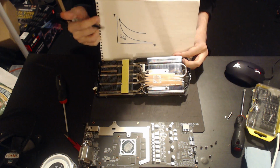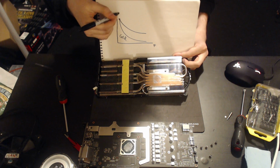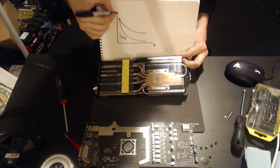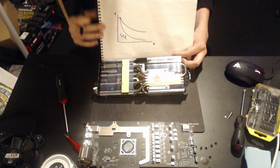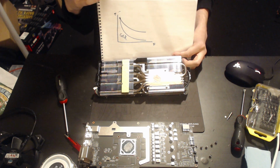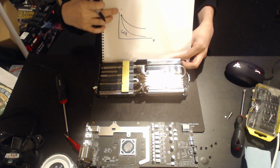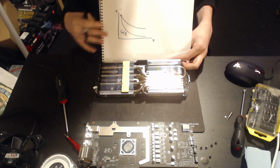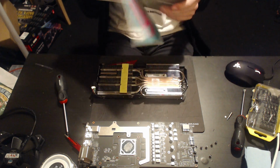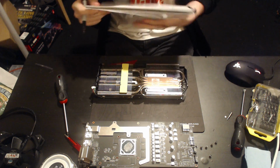So yeah, other than that, the specific STRIX sample I have starts a few degrees above the GTR. So if you took that curve and moved it like 5 degrees up at every point, or, well, actually here the movement up gets worse. Towards the maximum cooling performance, the GTR really, really wins. But at low fan speed, the GTR is not that much better.